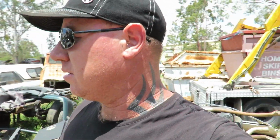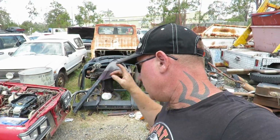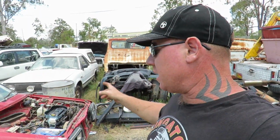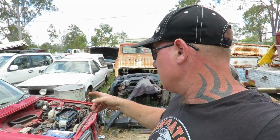It got hot and blew the head gasket because the fans aren't coming on. The fans should come on. Yep. Well, that's the result. At least we know the motor runs. The bottom end's good. We can go from there. It'll be all right. Right, so all in all, it was a successful mission. It is running, but the motor's got to come out. So we'll pull it out, do head gaskets, put a clutch in it, and go from there.